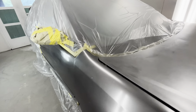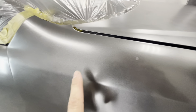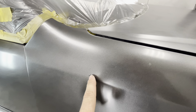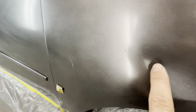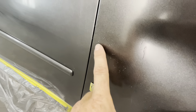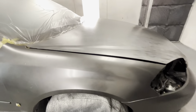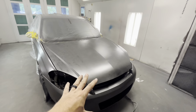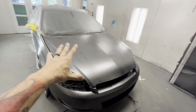Let's see if I can find any other flaws. There is your tree sap that Eddie did not get off. Normally I encourage my guys prepping to get tree sap off — all you have to do is take a little bit of paint thinner and wipe it off, but that was missed. Now we are working fast, so I'll give it to them. The scratches — when you leave scratches behind, you can still see them even on a first coat of base, and that is also a form of rock chips and scratching. So that's our first coat — I'm going to completely spray this out and get it buried with our drop coat of base, then walk it again to show you what covered up.